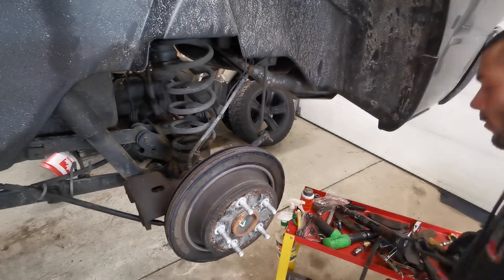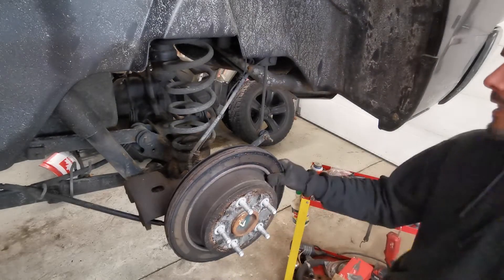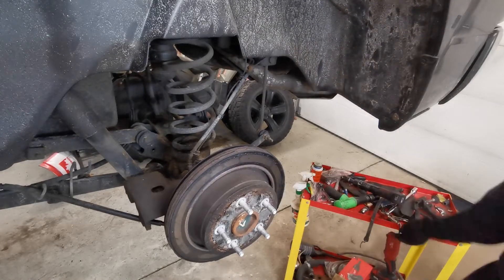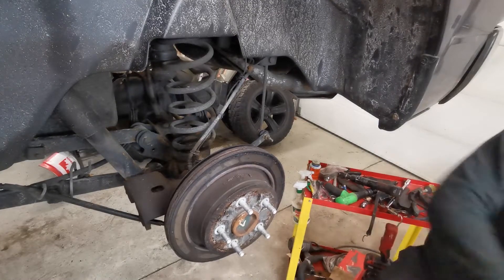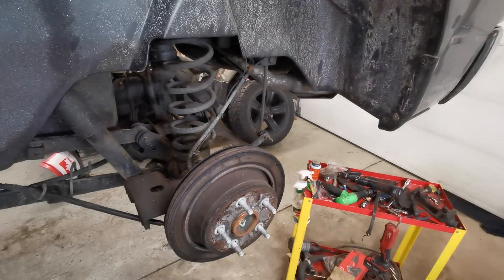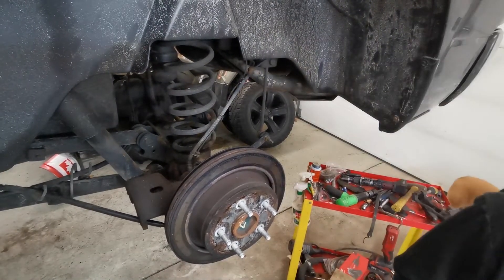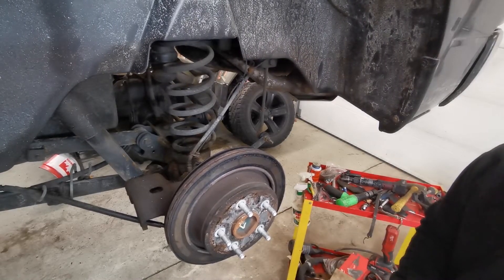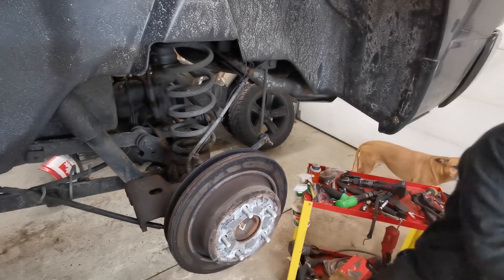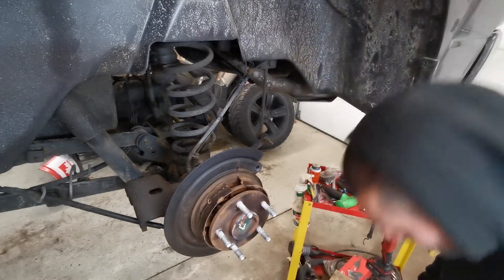In the meantime, we're going to take the rotor off. Sometimes rotors can be stubborn. I like to hit here because that's usually where it's seized — and actually that is where it's seized. As opposed to hitting up here, I've actually broken rotors that way where the ring will break and the top hat will stay, and then it becomes a real fight. After a few hits with no luck, we've got a stubborn unit, so we're going to need some heat. I'm going to apply the heat right here where it's seized — and usually just with heat, winner.